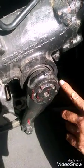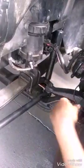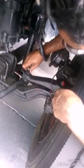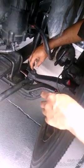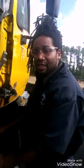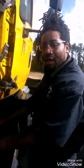So that's good. We'll go down to our pitman arm, check our pitman arm for cracks or breaks. And there's no cracks or breaks there. So spindle, and our spindle looks pretty good. It doesn't have any cracks, it's not broken. Our bolts here, we will usually check our drums to make sure that we have the proper clearance, but we don't have a drum on here, we have disc brakes. So in order for us to check these brakes on here, we would have to pull the tire off and separate the caliper to measure our pad for our right clearance.